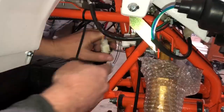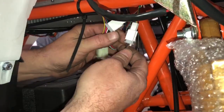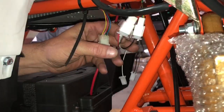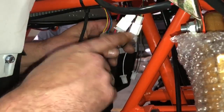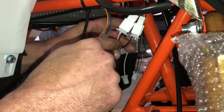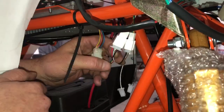When going to the wiring harness from the controller, these are the two plugs you'll be plugging in. Down here at the bottom you'll notice it's a red, a green and white, and a black. These two go to a black and a brown — so this is forward and this is reverse. The plugs you want to hook up for forward and reverse on your hand throttle are these two plugs here. From the controller it's going to be a brown and black going to a green and yellow, and then from the controller to your throttle control it's going to be a red, a green and white, and a black.